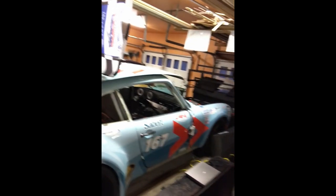Those are four what they call battery monoliths. People say it must be a high-voltage system — it isn't, it's 110 volts — but you'd be surprised at how many amps this is: it's 4,000 amps. So it's a ton of amperage going from four batteries back to eight motors in the back of the car. The result is a really fast race car that looks old on the outside — the body is about 50 years old — but everything inside is very young, a year or two old. We kind of think this is the future of hot rodding, and we're proud to be pioneers in it.